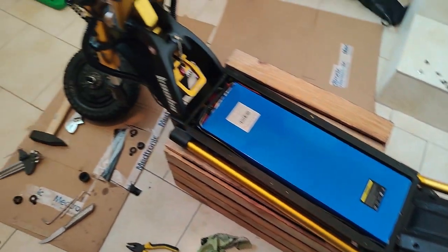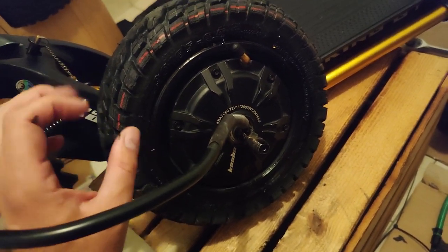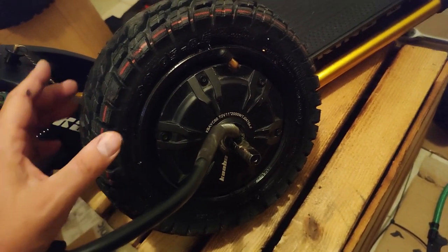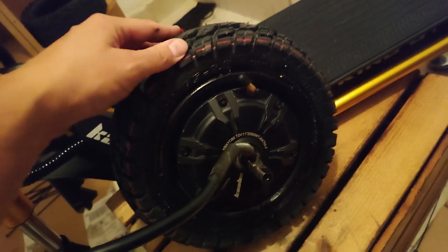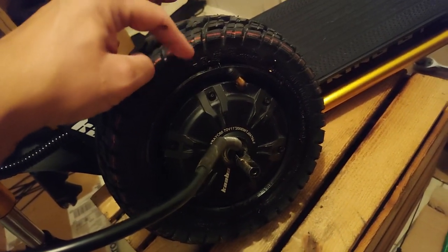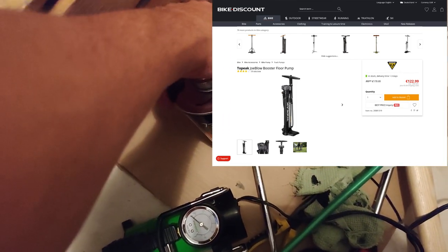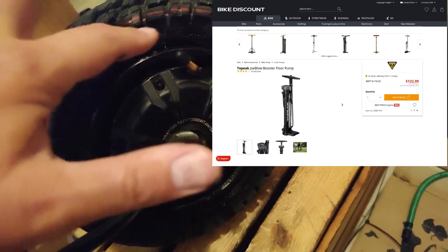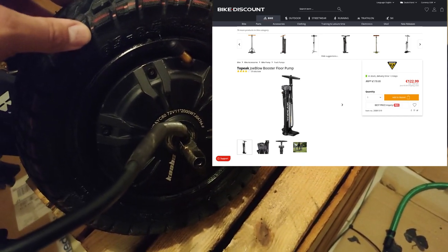Got the tires on. What you need at your disposal if you're doing it at home is either a huge electric-powered air compressor, which if you have, great. I have one back in the U.S., but don't have one here in Ukraine, unfortunately. Or you need one of the bike pumps with an air reservoir designed specifically for installing tubeless tires. That way you get a huge whoosh of air going in all at once at very high pressure, like they do at car tire changing stations, or in Ukraine it's called shinamontaj.